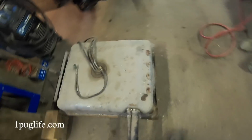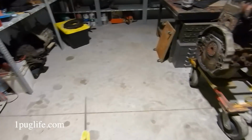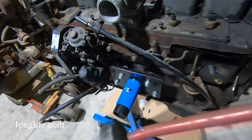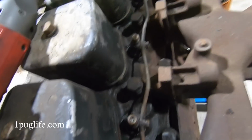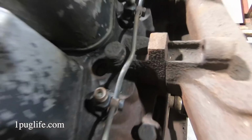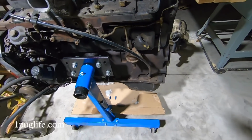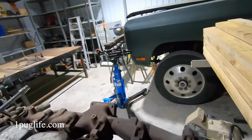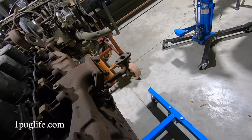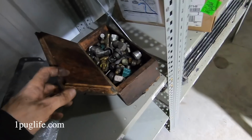Oh, the hobo got the fuel tank out. And look at all the lines. Fuel lines, brake lines, different lines. Deleted, to get this engine going, because I just got to make sure that it runs good before I go to the trouble of putting it in the Grumman. But just about every injector, you can see some not good stuff in there. I just got to make sure the injectors are cleaned out, the lines are cleaned out, and then we'll put the fuel lines back on. You know, pretty well undo everything buddy's frigged around. I got to plug a couple holes, and yeah, that really should be it. Hook up fuel, jump starter, hook power to the fuel pump, and yeah.